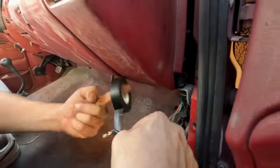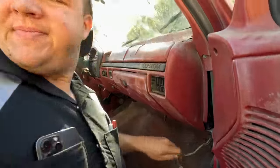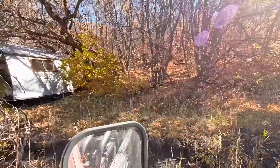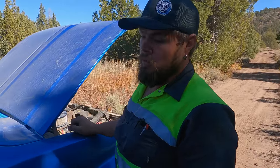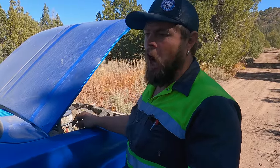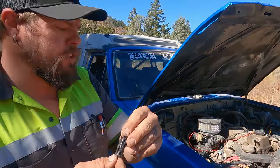We're just going to put this wire on - the taping might seem unnecessary, but it could arc out. We're waiting because we don't see Hillbilly. The tractor's running hotter than normal - I put a different carburetor on there and I think I might have it a little lean. If you have it lean it will run hot, so I'm going to adjust it. It's also idling high so I'll put an extra throttle spring on.